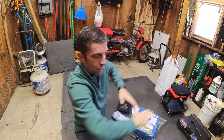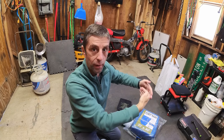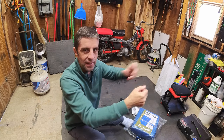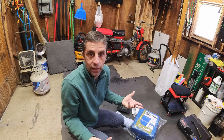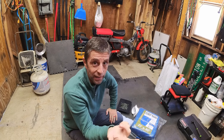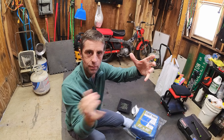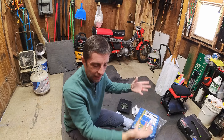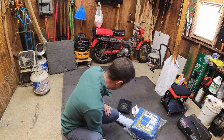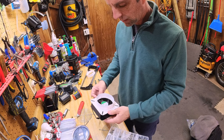I can flange right onto here with my dryer vent. I'll make the tarp go up the wall and then down the floor, and we'll put the bikes in there — whatever bikes we can fit. The idea is to put paracord around and make like a big Santa sack, basically. It'll positive-ventilate, and that's what keeps the corrosion away. The whole base of the tarp, the perimeter of it, just keeps critters from getting in to the bikes. That's my idea and I'm gonna build it — the holes line up perfectly, that's awesome.